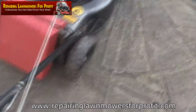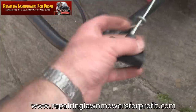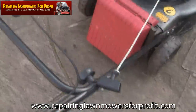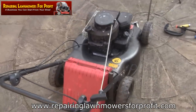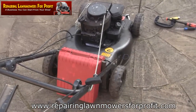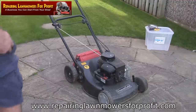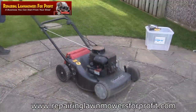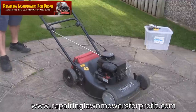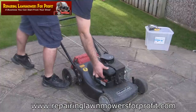You've got a nice shiny new pull cord here. This actually fits underneath here - put it underneath and let go of it, it goes like that and doesn't go any other way, then it pulls over nicely. The last thing to do is check there's nothing underneath this mower and make sure it starts. Always make sure there's nothing underneath after any repairs - you might have left tools there. We'll have a look and just pull this over and make sure it starts and recoils properly.